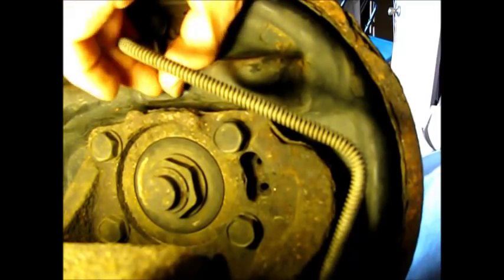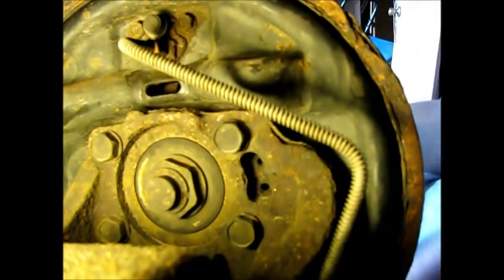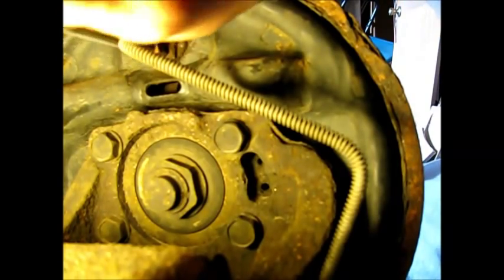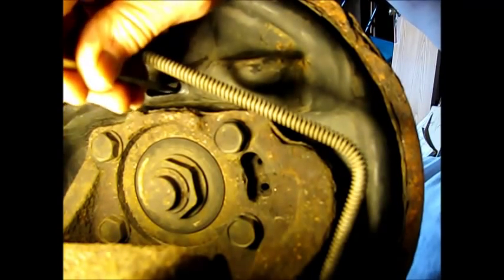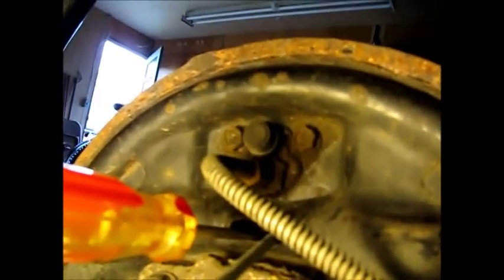First of all, let's take off the little dust cover. It's right underneath the brake line. And now, what I'm going to try to do with a long screwdriver is get at the release lever. You'll feel the spring tension on it. So if you can see this with one screwdriver, this longer one right here that's moving, I'm lifting the lever